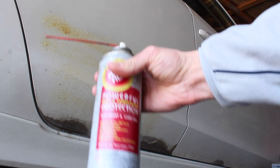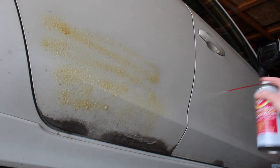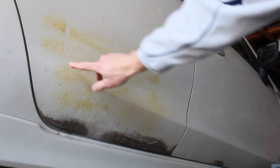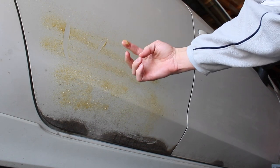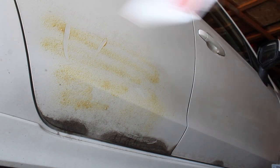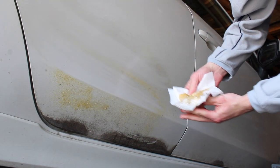They're up high underneath the frame and behind things. When you spray Fluid Film under there, it creeps — you can see it on the sides of the door and on the back hatch. I didn't spray any on the back hatch or on the doors; I sprayed up in the drain holes on the doors and the hatch, and it creeps around the outside of the car from the inside. It creeps about two inches in all directions, really getting into all those tiny spots you couldn't reach with a rubberized undercoating or paint without a lot of disassembly.